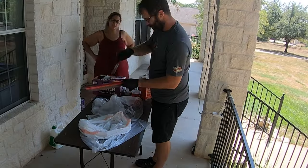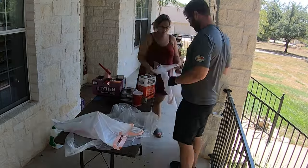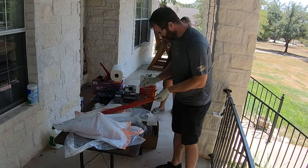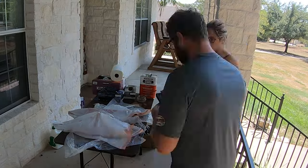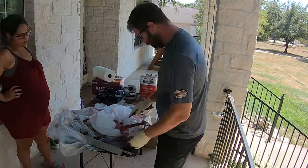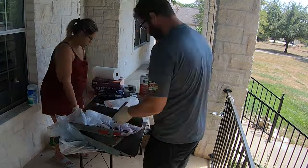Talk about a gnarly, nasty substance. We went to AutoZone and got Rust-Oleum Aircraft Stripper — that stuff does exactly what it says. Following Al's instructions: get a disposable paint brush, paint the stripper onto the part, then wrap it in a trash bag to keep the fumes in so it doesn't off-gas. Let it sit for about 15 to 20 minutes, take it out, and you can scrape it — it just peels right off. We did about two rounds of it at home and I thought I had it stripped.